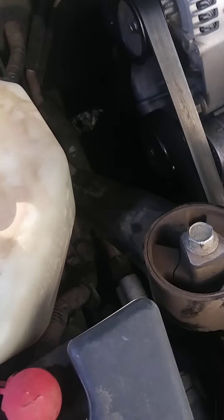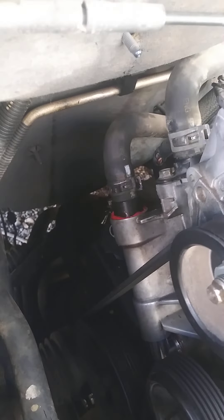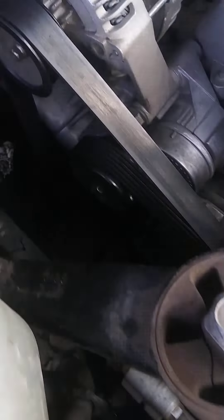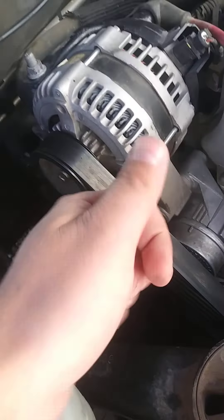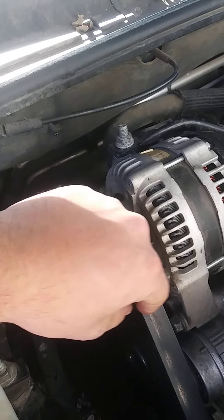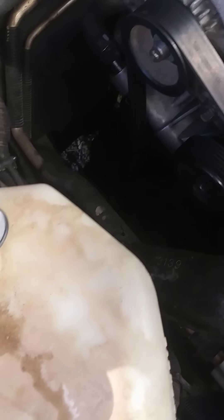To start off, you're going to take off your engine cover. Some of these you just take off the oil cap and the neck and the plastic just comes off. For this job you're going to need a 10 millimeter wrench and socket, a 15 millimeter wrench and socket, a small socket if you've got it, some pliers, and some gasket maker — RTV gasket maker. Get the red kind, the high temp.